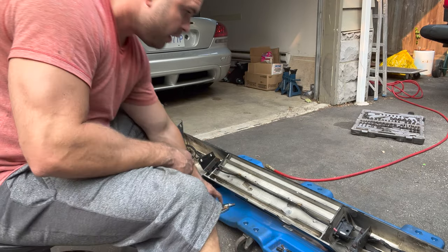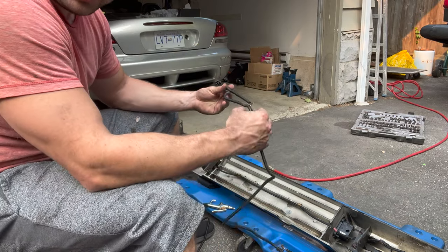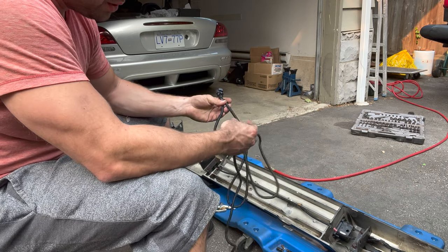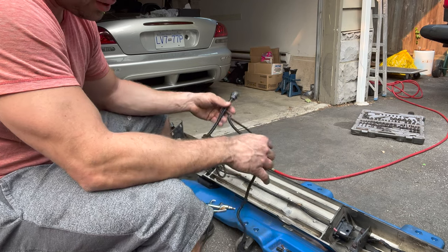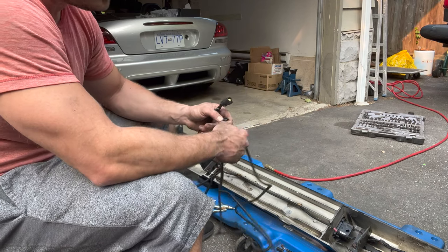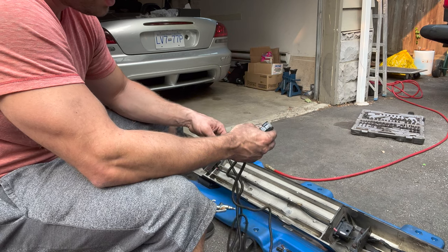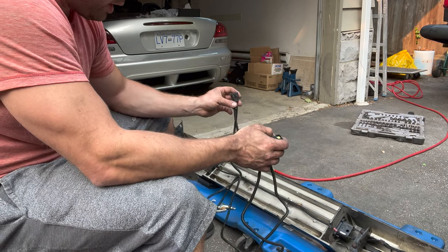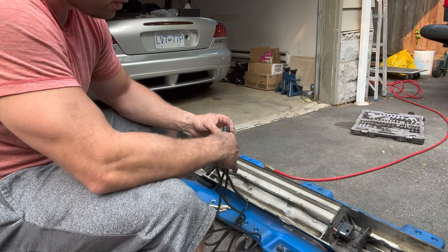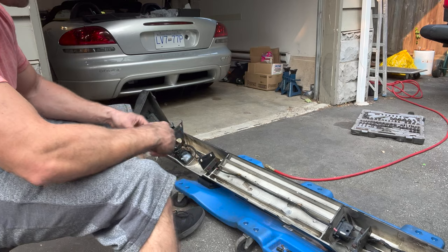Okay, so all my compressors go in here. I started looking at these reverse lights. So this is the new harness that comes with them. The instructions tell you to connect one set to the reverse lights and one set to the upper tail lights, which I'm assuming then what would happen is the surround part of the light would come on when your tail lights are on, which I don't really want. So what I'll do instead, I think, is I'll actually hook it up to the fog light like it's supposed to be. And then I'm not going to have any issues, and I also don't want too many weird lights on the back, so I'm going to try it that way and see what it does. But for now, I think we should have enough air pressure to blow those connectors out.